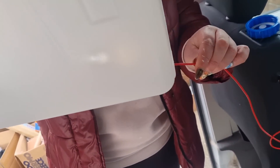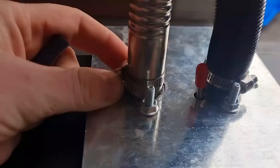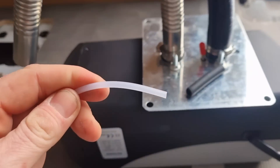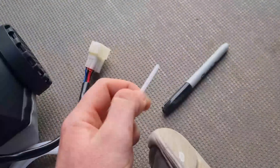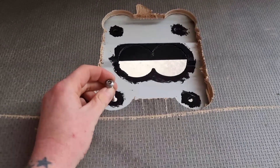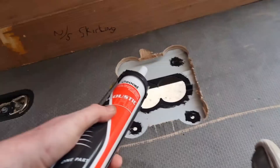Slowly but surely that'll come out. We rust-prevention treated the exposed metalwork, then fitted the fuel tank into the bag, stuck the hose on the actual outlet, and put a hole through the floor ready for the fuel pipe. She's actually done a really good job with the paint - a lot better than what I would have done. With the exhaust and air inlet fastened on tightly, we've got this hose that squeezes over the top and this hose to go into the other side. Top tip: grab yourself a sharpie and mark it so you know exactly how far you've gone in. We've got some big hefty anti-theft bolts to hold it in place.